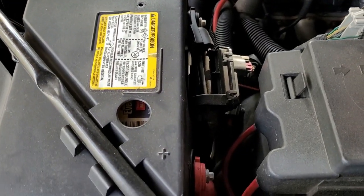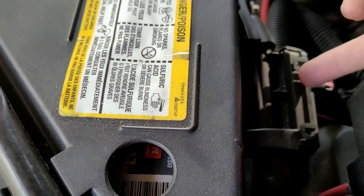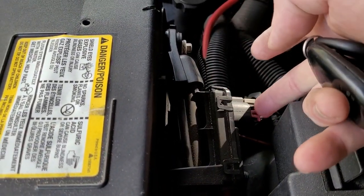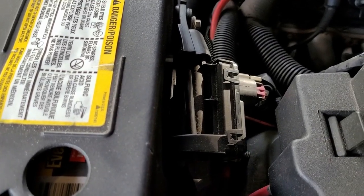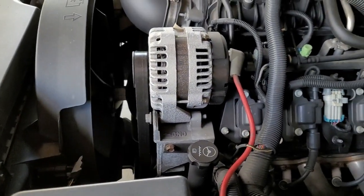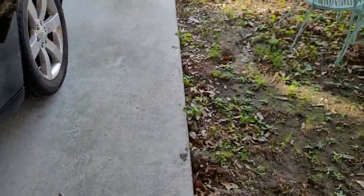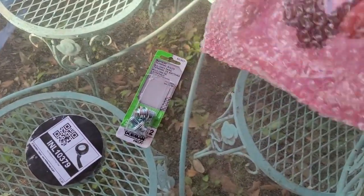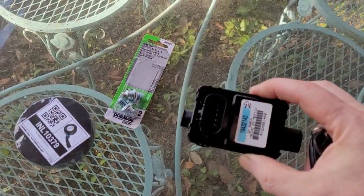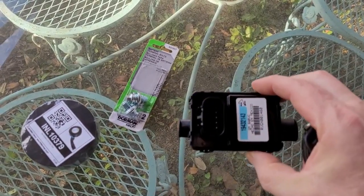After a little research I found there's a battery sensor. Here it is — it's tied in with the negative cable, here's the connection to it. This battery sensor sends information to the computer, and the computer tells the alternator how much voltage it needs to be putting out. We think this sensor is bad, so I bought a brand new AC Delco General Motors one and we're going to try to swap it out to fix the voltage spike.